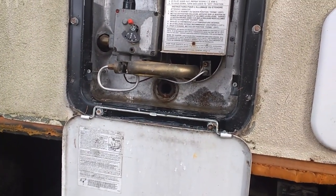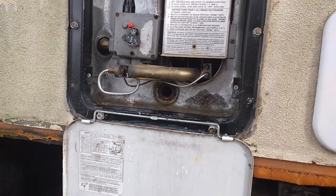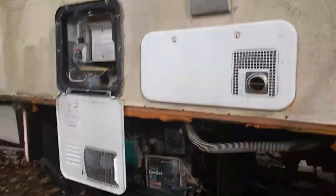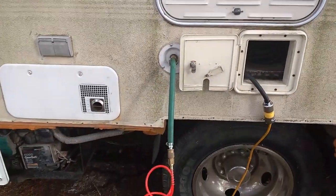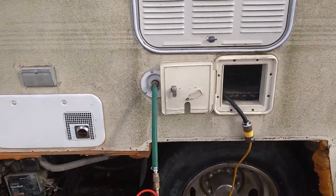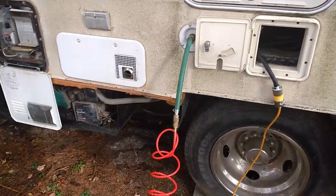Just a nice way of ensuring that all of the water is out of the water heater tank. I really like that method. And of course you could do this too, and then pressurize the lines and go inside the RV and turn on all the taps, and that will make sure that the lines inside will be free of water too.